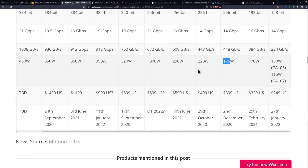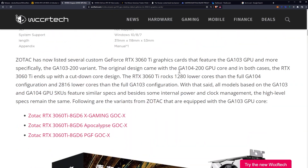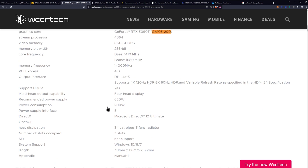Looking at the 175-watt TDP, I actually think I was wrong earlier. They went up from a GA104 to a GA103, and the power consumption appears to have gone up by 25 watts. So you'd actually want the older models. It looks like because they went from the GA104 to the GA103 — which is essentially a cut-down from the RTX 3080 Ti — you have worse power consumption on the GA103 versions of the 3060 Ti. So if you're specifically looking for mining with lower power consumption, the older GA104-based RTX 3060 Ti would be the one to purchase. Sorry for the on-the-fly correction — that's how it goes when you're live.